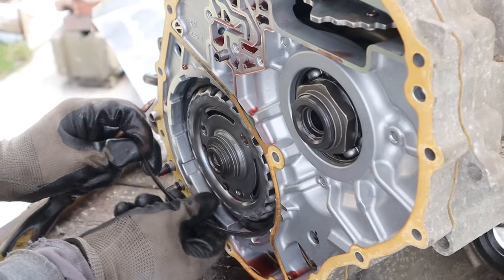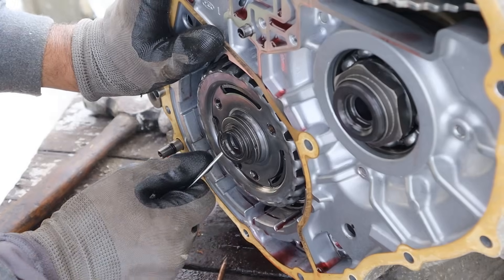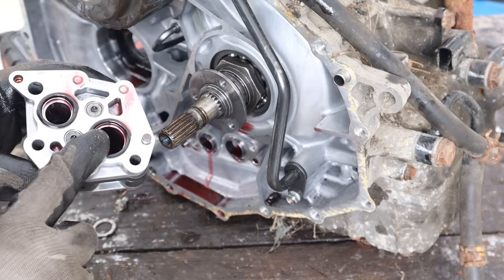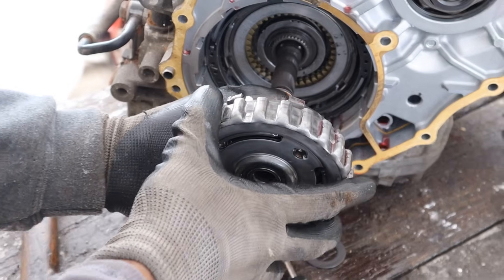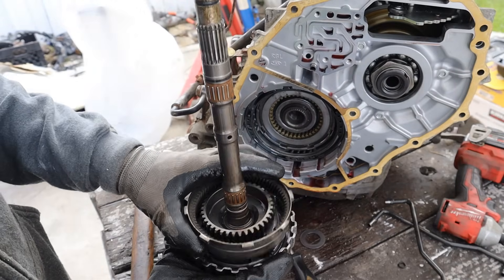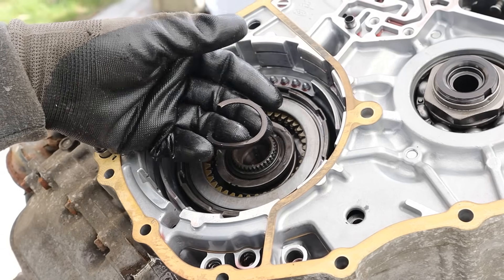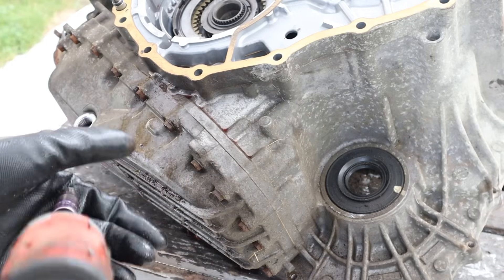Pulling off these two here — there's a snap ring, a steel plate, and a set of clutches that are in good condition. Let's get this oil pump off. For inlet and outlet — after removing a C-clip you can remove this flange, then push this shaft through and grab it from the other side. That's your input shaft. So you've got a planetary gear set — the input here is actually the sun gear, the output of which is this ring gear, which is splined inside here to the clutch, controlled by this piston and piston return spring. I also need to remove the transmission pan next.